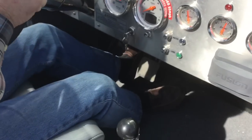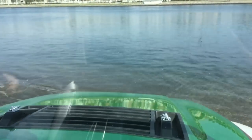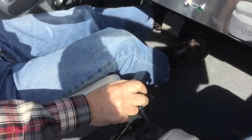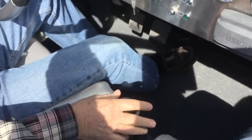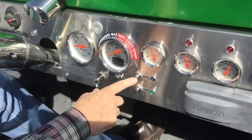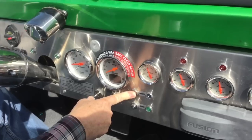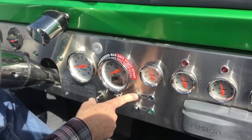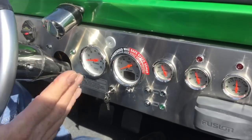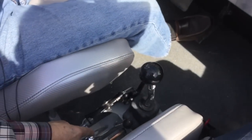Let's get wet. I drive into the water, depress the clutch, and just let it roll out and drift away from the shore. Particularly if there's any litter along the shore, it's nice not to catch it up in the jets. Now I'm going to raise the wheels, so I go to the water button here — water mode — and press that. You'll see the warning light has come off because the wheels aren't fully depressed anymore. That blue light and the audible alarm have told us that the wheels are up. So I'm in neutral, the jet's engaged, and the wheels are up.